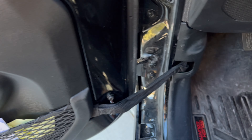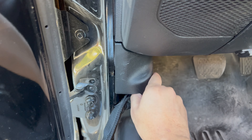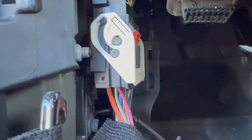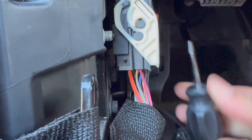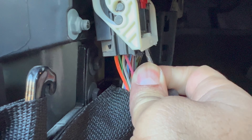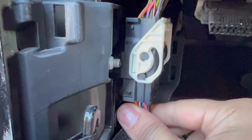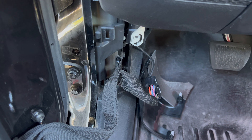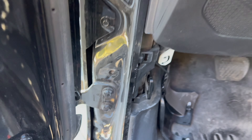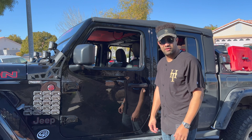You're going to notice the only thing left is the harness and the door holder itself. Grab this and pull it towards you to pop it off. Then take your flathead screwdriver and press up on that red tab to loosen it. Where you see a little tiny sliver, put the screwdriver there and pry up on it, then use your finger to push up to release and pull straight down on the harness. Then pull the door latch straight off the locking mechanism.